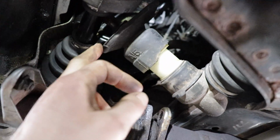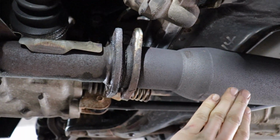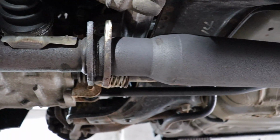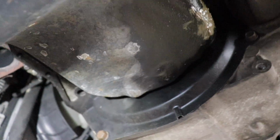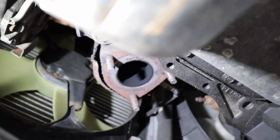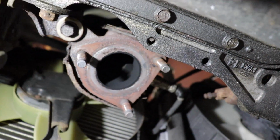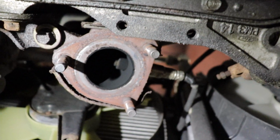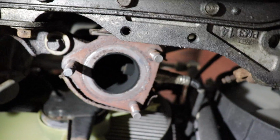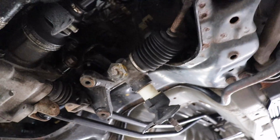So as you can see, we tried turning this upside down, but it's hitting the exhaust now to get out. We're gonna try and do it with just removing this part, because they do say both the manifold and the exhaust. Hopefully we don't have to do that. We'll wiggle it out. We definitely had to pull that pipe down off the manifold that goes to the rest of the exhaust. Just makes everything a lot easier. It wasn't hard. The studs look really clean. The nuts were really bad, so I just didn't even try it. We heated them anyway, because if I even have a question whether the exhaust bolt might round or break, I always heat them so I don't have any issues coming off and going back on.